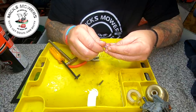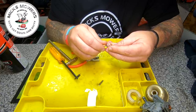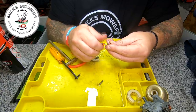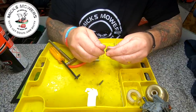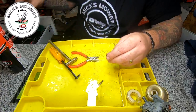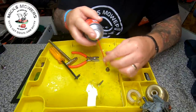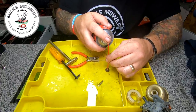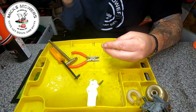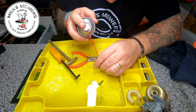I can't tell you what size it is — I can't read the writing on there at all. What I do is I just drill these out ever so slightly. You have to be a bit careful because they do snap, so you have to drill it ever so gently. In it goes — and then just back out again, back in again, and eventually it just bites. That's all you need to do. It's not even taking material off — it's just cleaning those walls back up again. It's a perfect size. Now when you spray, see it's coming out of both sides — which is exactly what you want. I use little micro drill bits just to get around that issue. If you don't, you're going to have problems.